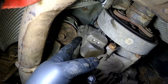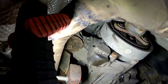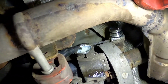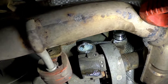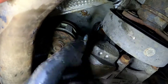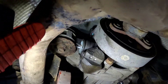Now we need to remove the paper filter — there are two 4mm bolts holding that on. Get yourself a pair of grips and give that a good twist; they can be a bit tricky to get off, them caps can. As you can see in there there's a paper filter which Volkswagen say isn't in there, so we need to get it out. A little tip: if you can't get these out, get a self-tapping screw, screw it into the middle, get yourself a pair of pliers and it'll just pry those out.